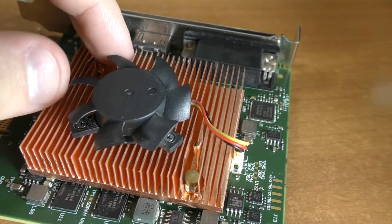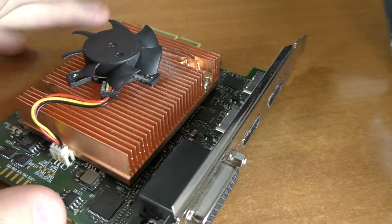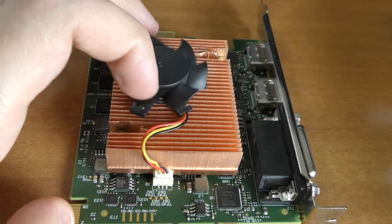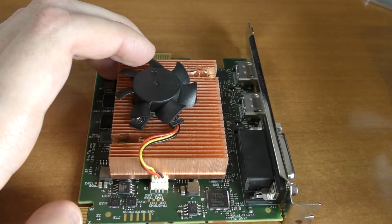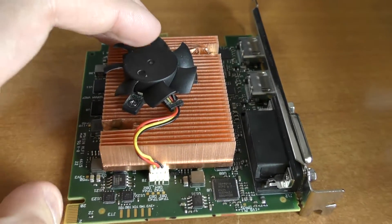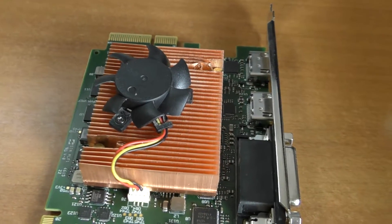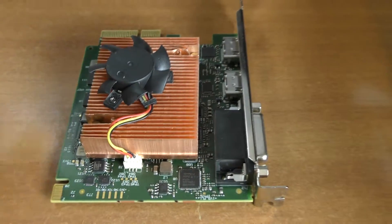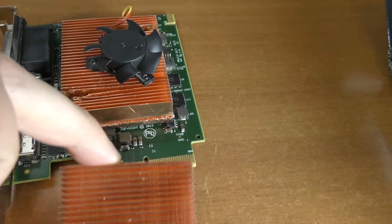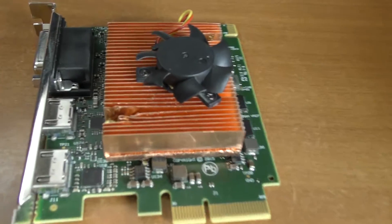You don't need to do anything else to make it hold. You just place it on top and turn it on. In this configuration with Full HD capture, it holds its temperature at around 45 degrees Celsius. Without this fan it would be around 50 degrees Celsius. My room temperature is now 24 degrees Celsius, with my lighting and CPU and GPU working at max settings. Just this little copper radiator solves all the problems with sound and heat — the terrible heat and terrible sound this capture card produces.